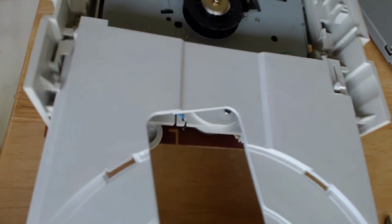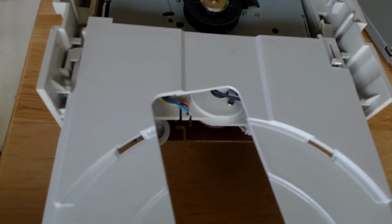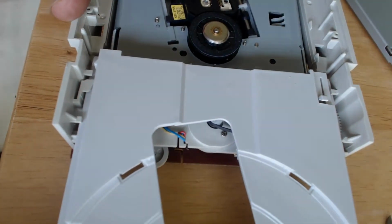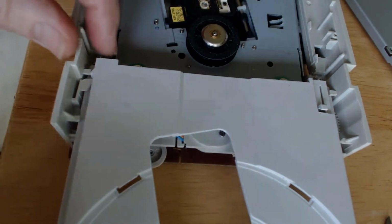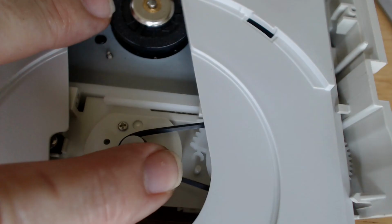Well, there's a little problem. Seems the little drive platter wants to come up a little bit prematurely, and when it does that, of course, it hits the back of the tray. Now here's where different manufacturers will have different schemes for this. But if you look in the tray entry area, you should see a little gear tab that connects up to a little stop pin. You need to get as close as you can to that little gear and the stop pin. That'll get the drive set in such a position that the drive will close and the platter won't come up until you're ready for it.